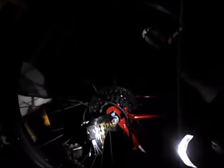There are some screws here, adjusting screws, which probably a lot of bike guys have covered on YouTube. I'll put links to people that will have info. So I've adjusted these screws so the chain happily jumps up to the cogs. As you saw, it was moving freely. I'll put it on the third cog. It's moving freely now. But I did have an issue with the lock nut.